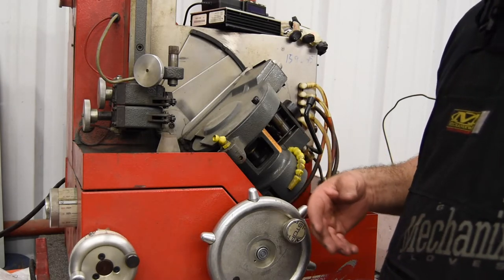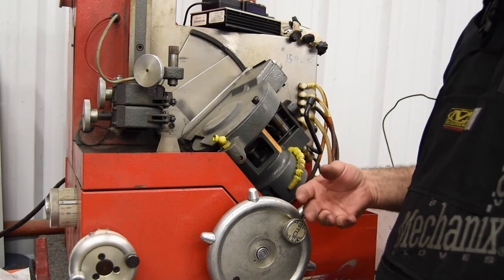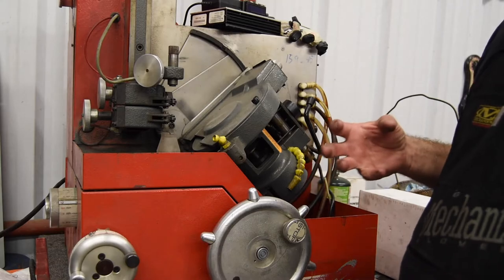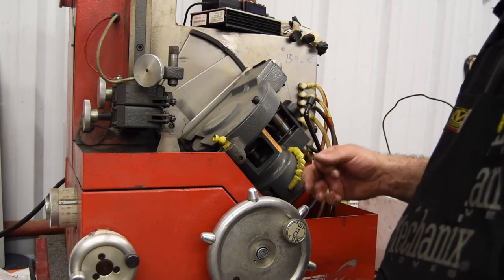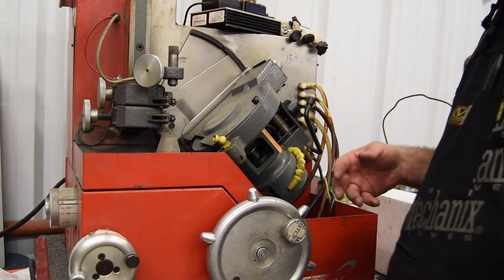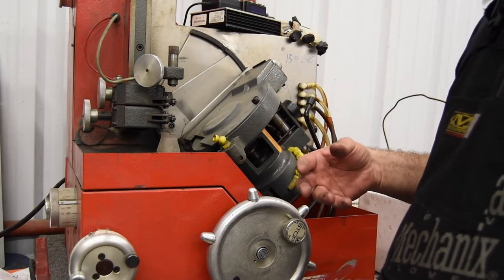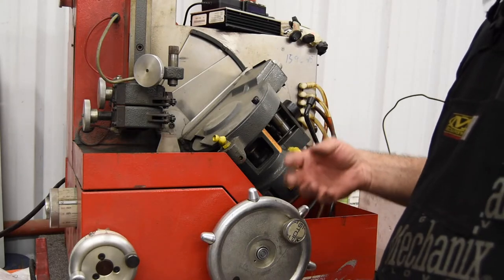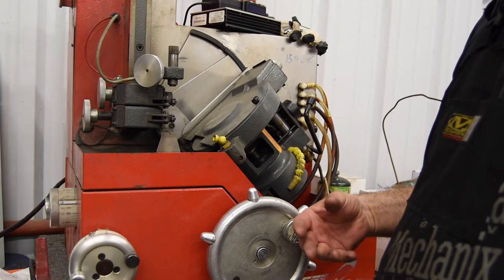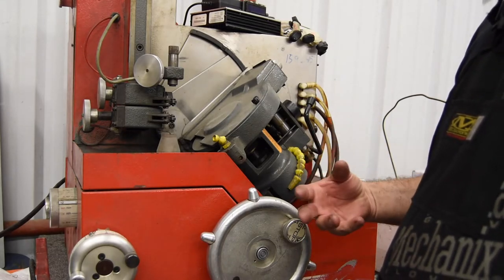That spindle then defines the path in which that valve is going to rotate on. So those are really good if you have valves with worn valve stems and you need to reuse them, because they're going to grind a round seat or a concentric seat with some arbitrary axis. And any of the valve stem to guide clearance, if it's anything at all, that valve will then still be able to seal.